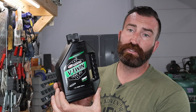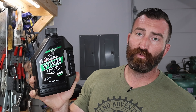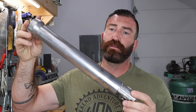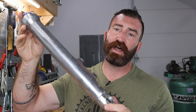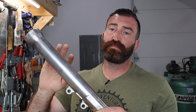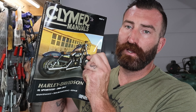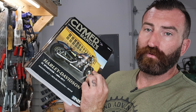For the fork oil I'll be using, this is Maxima V-Twin fork oil — 20 weight, so we're going to go a little heavier with the fork oil. The fork sliders I've cleaned up; I did use a paint stripper on these and then a wire wheel to get rid of all of the black that's on there. I'm going to be repainting these after we get them all put back together. When I am reassembling this bike and all the parts, I am using the Clymer manual for the Harley XL Sportster 04-13.